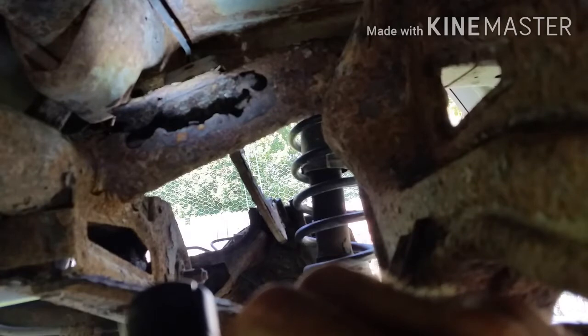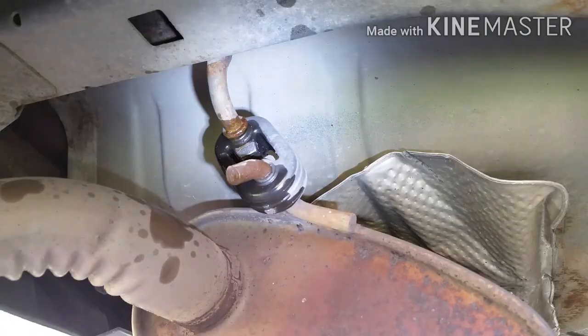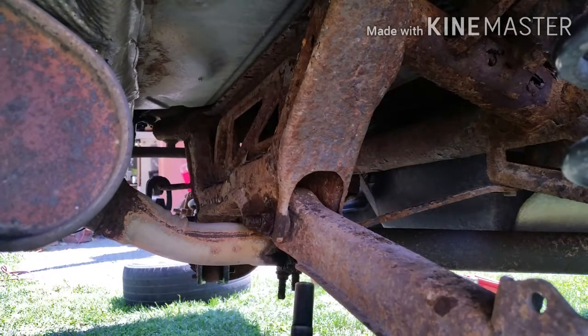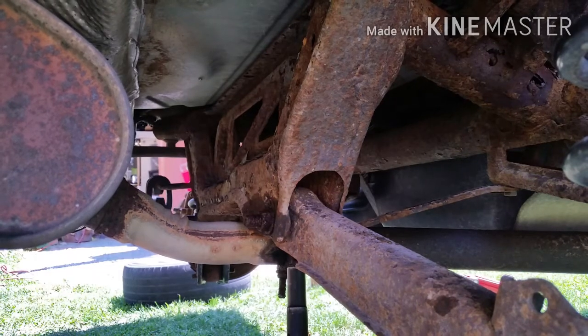Here's a quick view of what the northern climate can do to cheap imported steel — skate right through it. Thanks to the salt and rust on the roads, we're gonna start tearing it apart piece by piece, starting with the exhaust system. The only part I'm gonna take off is the muffler. We're gonna take these little rubber grommets off to get the muffler to drop down, and remove the exhaust pipe clamp at the back. Let's get the muffler out of the way so we can work around it.